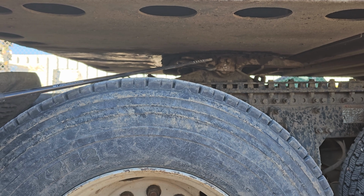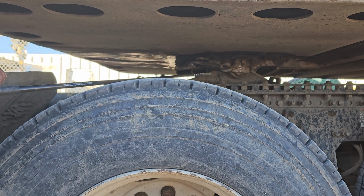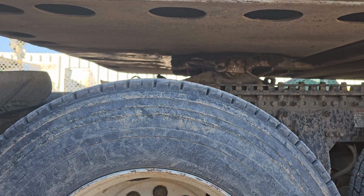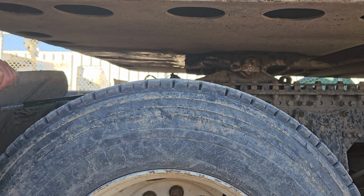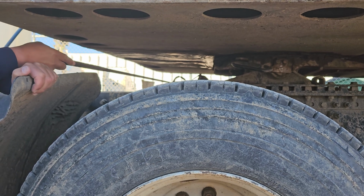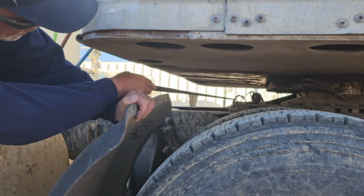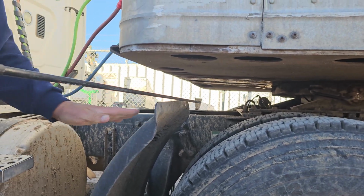They're locked around the kingpin, which shows it was not bent, shows no signs of mushrooming. It all sits on the platform and the mounting bolts, which is securely mounted. There are no cracks and no illegal welds. And it's all locked in by the slide lock, which is secure and locked into place. And there are no audible leaks from the airlines.